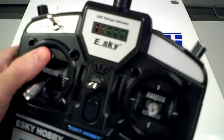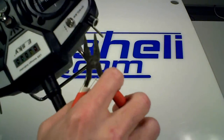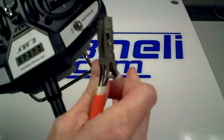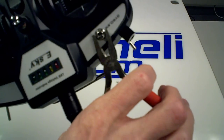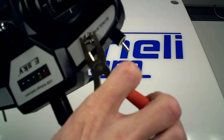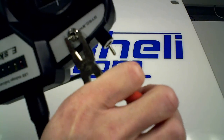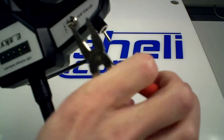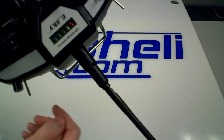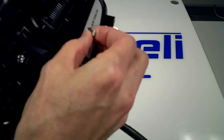The first step is to take some small pliers, possibly with small teeth on them. Be careful not to scratch the placard — keep it level and grip the retaining ring. Rotate that ring counterclockwise. Once it comes off about a quarter to half a turn, you should be able to loosen it with your fingers. You don't have to take it off completely, just loosen it.